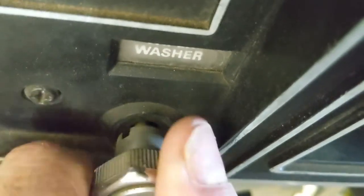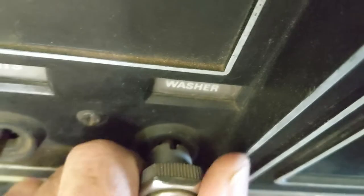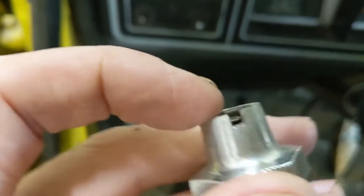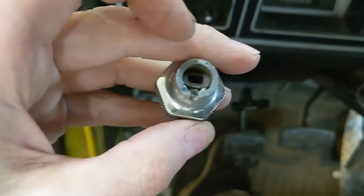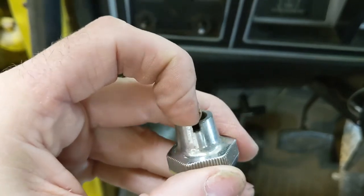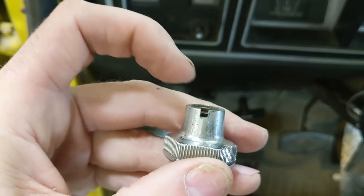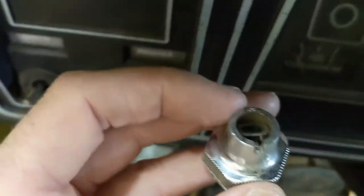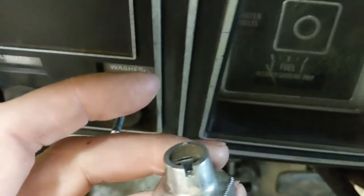There's a little tab in here that you can push down on and it'll pop that out. There's a little slot and a little metal clip on the back of that knob — it grips onto the shaft like a caulking gun. If you had a screwdriver you could pry that clip forward through this little slot and pop the knob off. I just yanked it off — probably not the best thing to do — but it's just a friction fit on the shaft so it's not hurting anything. If you're having trouble and don't want to hurt anything, just pry that clip back.